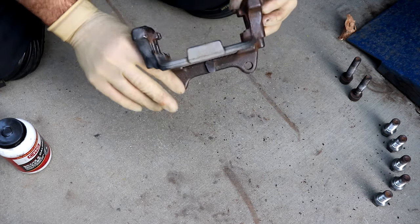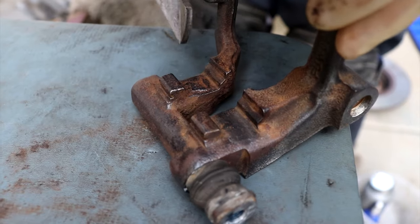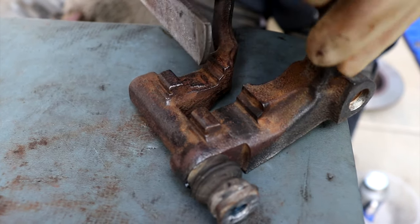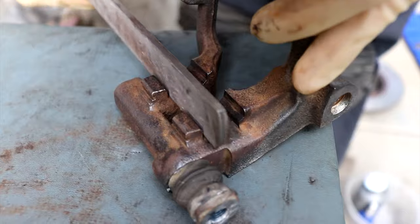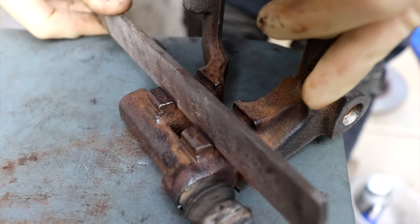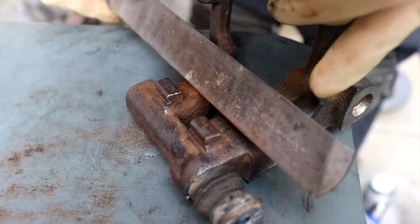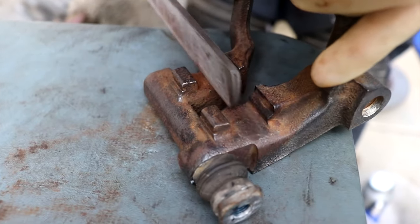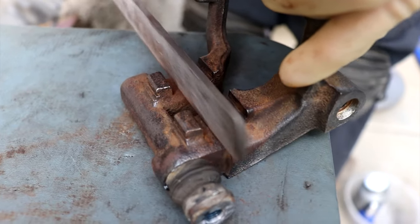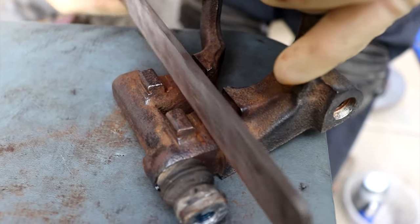On the carrier you have two of these little slide pins — they're just held in with rubber so you just give them a little tug and pull them out. You want to make sure that you get your brake grease and lube them up, then put them back in and make sure they're fully seated. Now we're ready to reinstall this bracket. I noticed a little bit of corrosion after doing the wire wheel, so I'm just going to take a flat file and clean that up — you've got some rust buildup there. You want these surfaces to be nice and clean because this is where that pad retainer clip goes — you don't want it jammed in there.